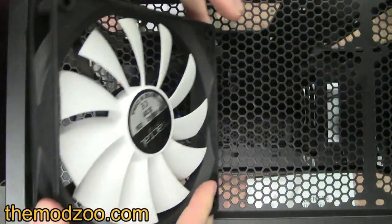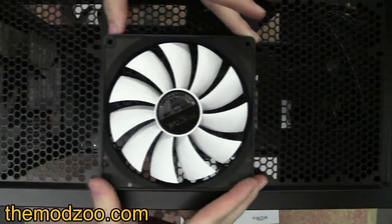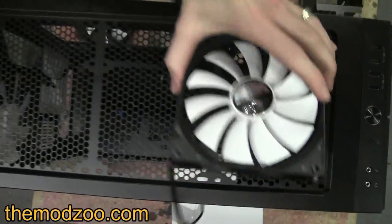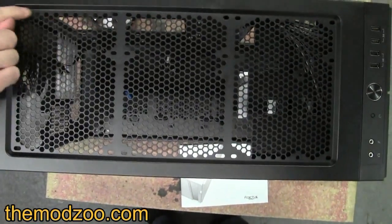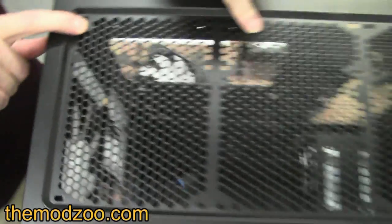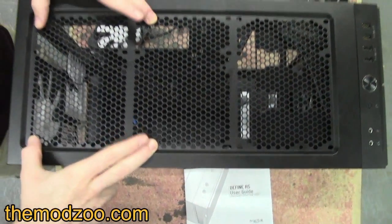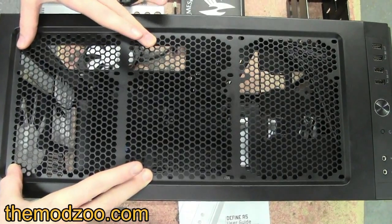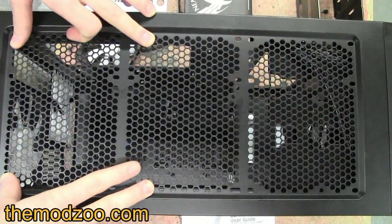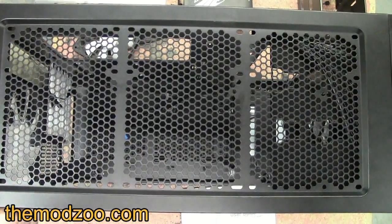But you also have slots actually for the 140s, but you can have a 140 here, again in the middle, and then on the end. And then these slots here are just for the ModuVents, these little top panel cover things. So those aren't actually for mounting anything. But there's also a set of 4 screws, or 3 holes technically. There's one here, here, and then there's one over here. And then you would use the corner that fit a 180 millimeter fan, or presumably radiator, but you'll probably run into clearance issues if you're trying to use a radiator for that. But so there's mounting holes for a single 180 millimeter radiator fan as well.